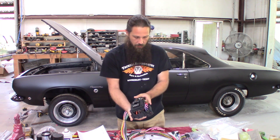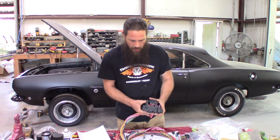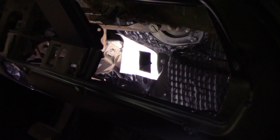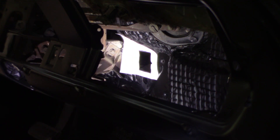It's a pretty simple, very well put together device. Let's start with step one. We've got to get two holes drilled into our firewall so we can mount our new fuse panel. This comes with the kit — you cut out this paper template, it lines up with the little triangle notch, and we get two holes that need to be drilled to mount the new box.